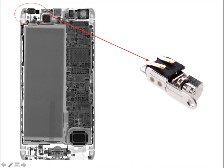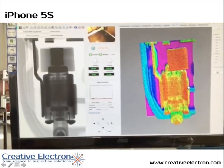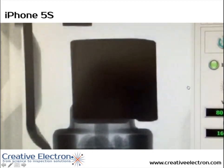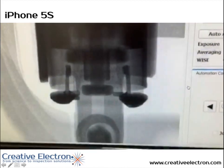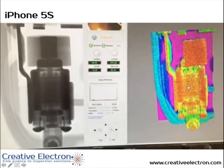It's a rotary motor, as you can see here, with an off-balance shaft, so when the motor rotates the off-balance shaft causes the whole structure to vibrate. Here's an x-ray in real time of the iPhone 5s with the vibration motor in action. This is a fully functioning motor — we actually called the phone from inside the x-ray machine — and you can see full operation running at 30 frames per second on this high-speed x-ray camera.